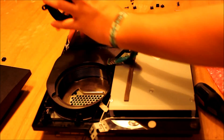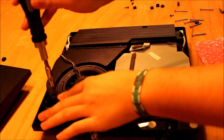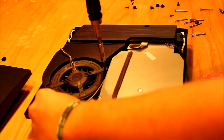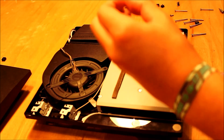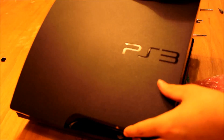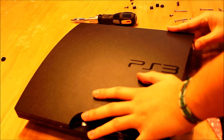Once those are in, replace the fan — two black screws. And then these at the front: the black one goes furthest away; they just fit over like that. Then there's a silver screw each — small little silver things. Now we should be ready for the case to go back on. It goes down front end first; put it at an angle, make sure it drops in there. Make sure it's flushed down, and now we can slip it over.